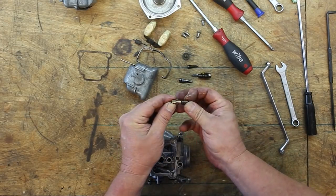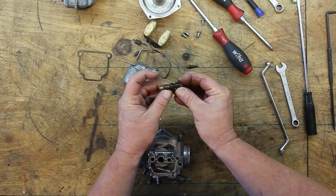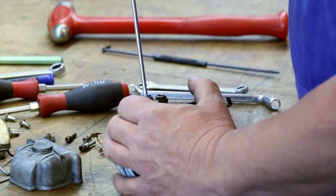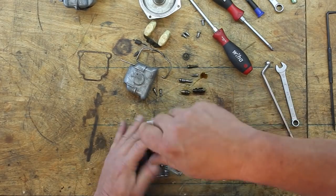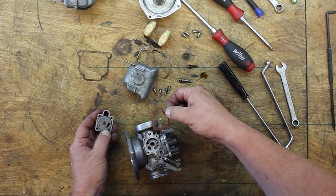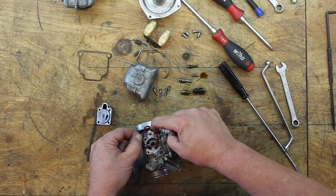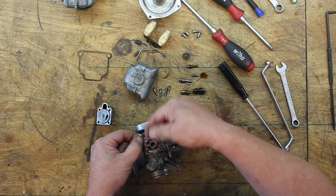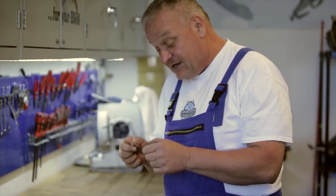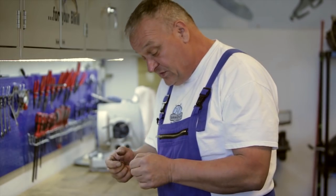The main jet and diffuser go together like that. Now we're going to take the chokes off. This gasket stayed nicely in place, but sometimes you'll notice that this part of the gasket has been sucked in and you get a vacuum leak — that's a source of bad running. Always want to look at these choke gaskets, but anyway they'll get replaced. This one actually didn't get deformed at all.